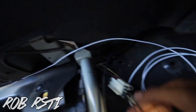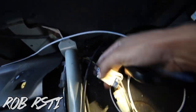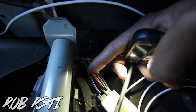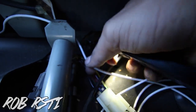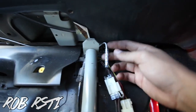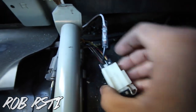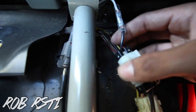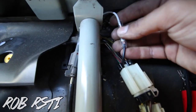Now you're gonna have to find this white connection. The wires are gonna have a black with a red stripe, and then a plain black. This is very important — from the body side, not the harness side, you're gonna have to cut the black wire about this much, and crimp this white wire to that black wire. iWire does provide the crimp, which is really cool. So the body side black wire gets cut and the white wire is crimped onto it. This goes to your fuel pump, and that's it.